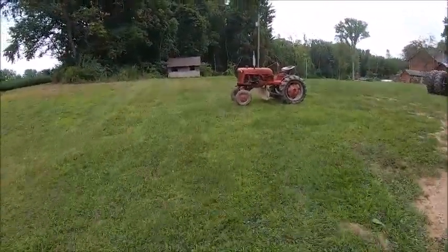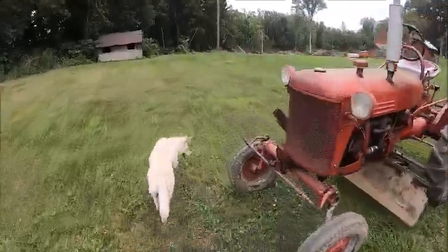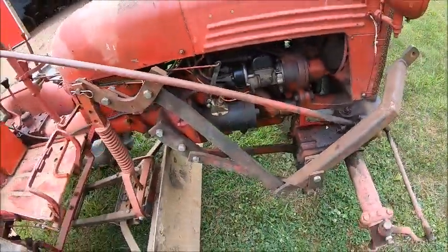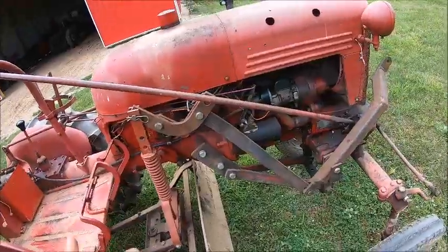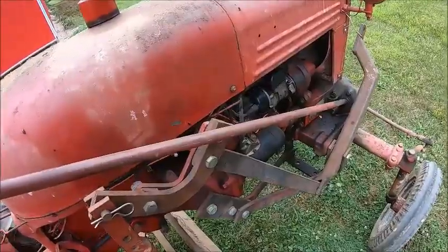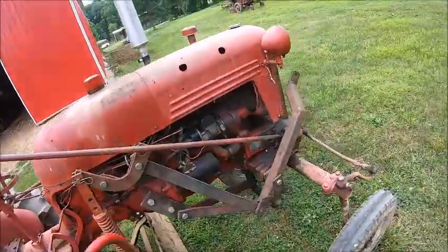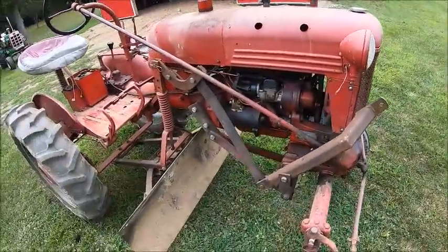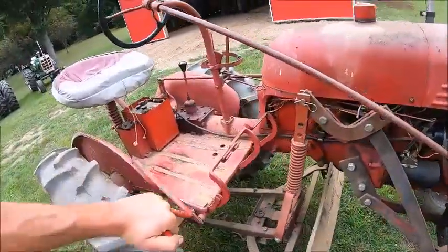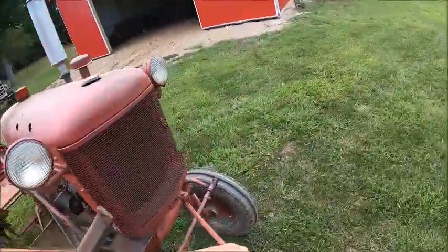My damn, the button there, the starter button on the starter. That guy right there apparently got some moisture in it, or the connection came loose or something, because it no worky, and the battery's fine. It's been acting up on me for the last couple months, and the other day I went to move it and it finally didn't want to go. So luckily she starts easy enough off a crank.